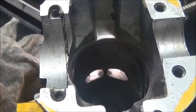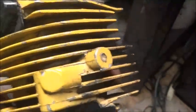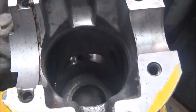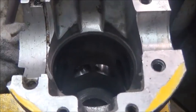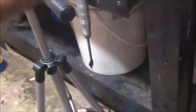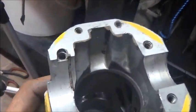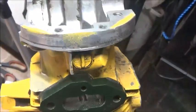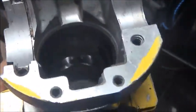Usually end up around 104 degrees on these after I do this, and that's a good safe number. It's not going to lose any compression there. That's capable of having a good clean 4-stroke if everything else is right at over 13 grand. I usually tune these things to around 12.5, and they're fat and happy there and have plenty of torque in the cut, and do just fine. Others I've done different, turned up hotter and just didn't like them and either got rid of the saw or tore it down and redone it.